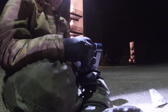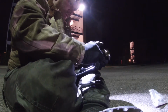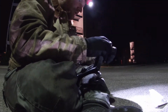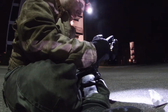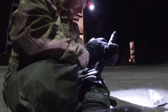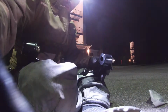Alright, so to get these polyurethane bushings in on this one, you just press them in. You shouldn't have to use any type of ball joint press. Fortunately, I had to use a ball joint press on the lower ones. That's the only way they would go in. But you just work them in, just like that. Same thing for the other side. You take the pin, push the pin through. Actually, I'm going to do it the other way. The pin may need some persuasion with a mallet, which I'm going to have to hit it with, unfortunately. So let me get it hit, and I'll show you guys the finished product.